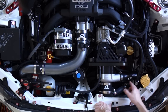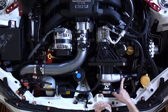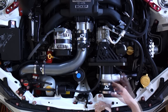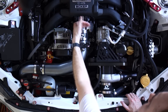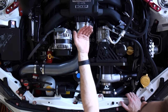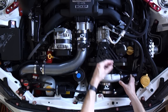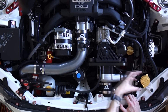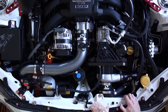What the blow-off valve is doing is bleeding off excess pressure. You can imagine the air is rushing out of the turbo or out of the supercharger, pressurised, and then it reaches the butterfly valve. Now if that butterfly valve is closed - if you're in a closed throttle state - there's nowhere for that air to go. It's just sitting in between and being forced out still because the supercharger or the turbo is still running, still compressing air, but there's nowhere for that air to go. Now that can create two scenarios.